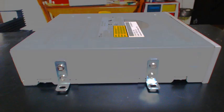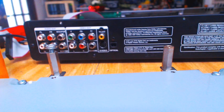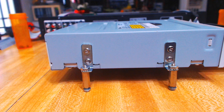Several things made the swap fairly easy. The backup drive has four brackets that attached it inside the plastic case. The existing drive sat higher in the case due to two brackets that had to be removed. Once they were out, the holes in the bottom of the case don't come anywhere close to lining up, so I had to drill four new holes. All this new hardware came from my 6-32 bolt stash, and these circuit board spacers measure just about perfect — approximately one inch tall, which stood the drive up just high enough where the drive door would slide open when the slot tray slid out.